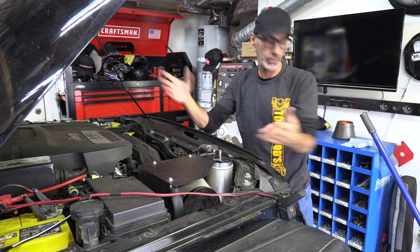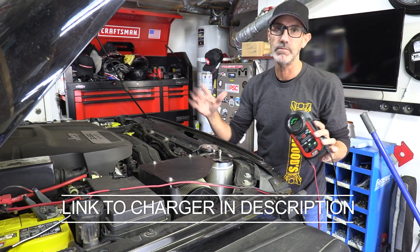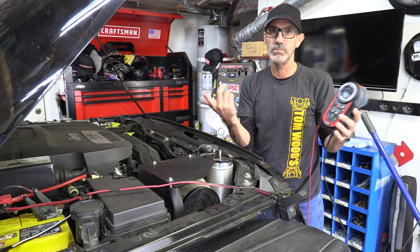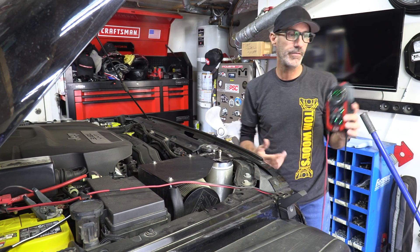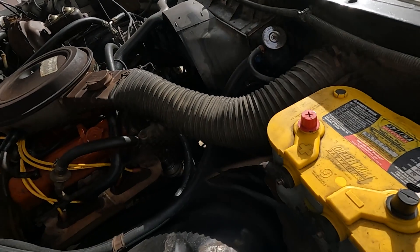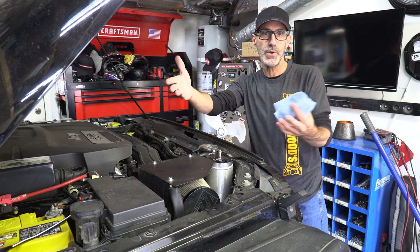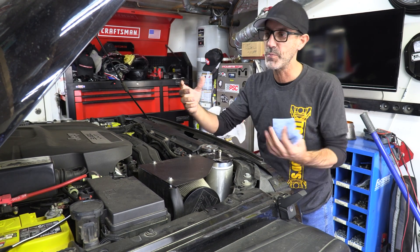While we're here in the engine bay, let's also talk about battery maintenance. I overly take care of my batteries and they last a decade because of that. Just throw your battery on a charger periodically — I did a video featuring all of my Optima stuff and this charger is amazing. Even if you drive your vehicle all the time, put it on overnight once in a while to let it condition. Right now it's saying 'maintaining 12-volt battery.' That kind of overnight conditioning keeps the cells healthier and makes a huge difference.